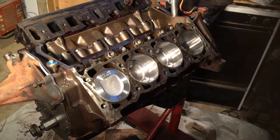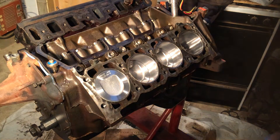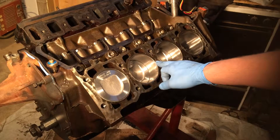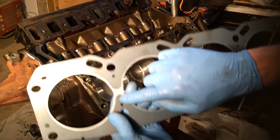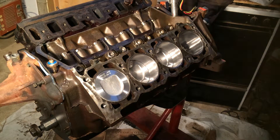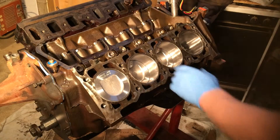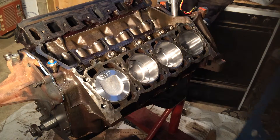Just a note to anyone that uses a Felpro gasket set for this engine — there's nothing that indicates the up on this gasket. But if you notice on the deck, these little spaces here, you can see this part was facing down like that. This car had no issues with head gaskets or the heads, no overheating issues or cooling issues, so that's the way I'm just going to be sticking them back on. Also, after you have your cylinders all oiled down, you want to remove any excess oil you got on the deck, because these have to go on dry.